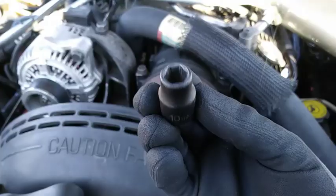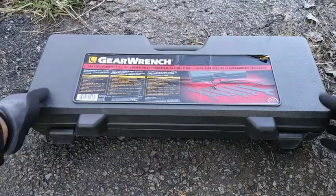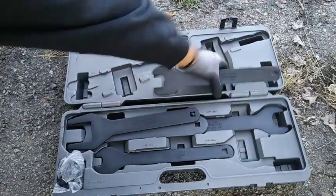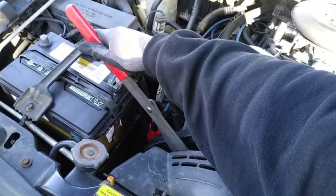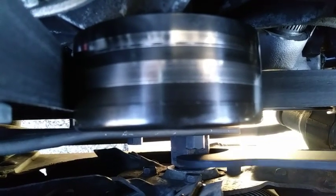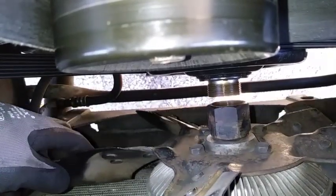There are just two fasteners on the shroud and you'll need a 10mm socket for removal. My Jeep has the clutch fan, so I'm using the GearWrench fan clutch service kit. I'll leave my review video in the description below for a more in-depth look at how to use this tool. Once you crack the fan nut loose you can easily spin it off by hand. Make sure you're holding on to it though so it doesn't drop and damage your radiator.